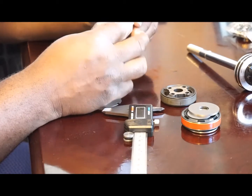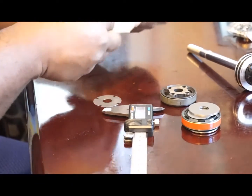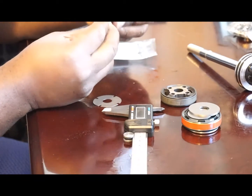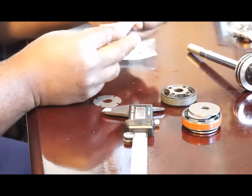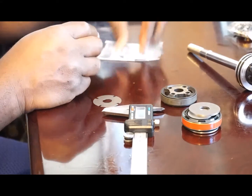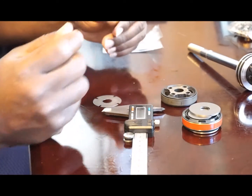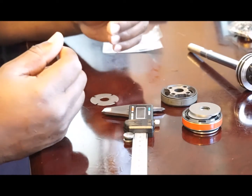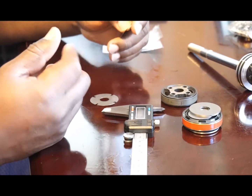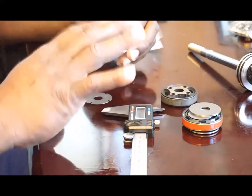I actually have this profile on the front of my vehicle now and it's pretty decent. I have it with 14k springs, so it's more of a 70-75% track-oriented setup and 30% street in my opinion. I'm going to try switching to a 10 kilogram per millimeter spring and see how that goes with the same shock profile.